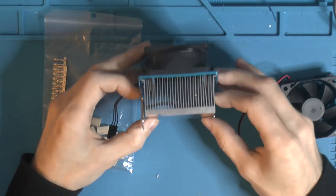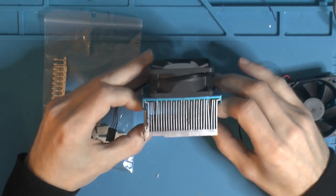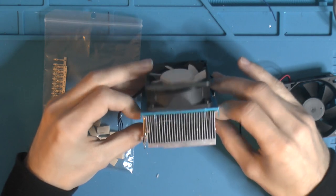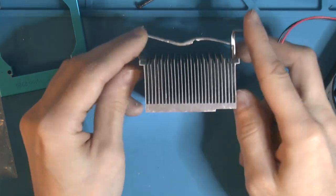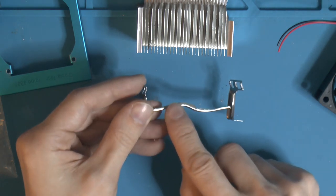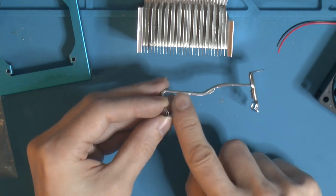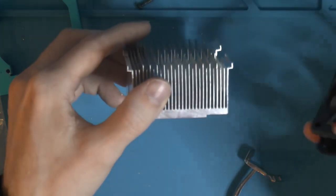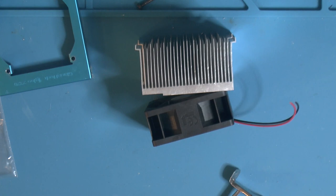Something I didn't mention with the CPU is that the IHS is now 3.1mm tall from the Sempron donor, whereas the real one is like 1.6mm mounted — 1.5mm if you just measure the IHS. An Athlon heatsink base is about 2mm, so stock coolers won't fit without modification. This cooler is modified — the clip is basically a piece of metal bent in a U shape, and I filed it down from around 3mm to 1.5mm, giving a 1.5mm difference. Otherwise the cooler would just sit up high and you'd break the socket trying to clip it on. That's something to keep in mind if you put a Sempron IHS on.